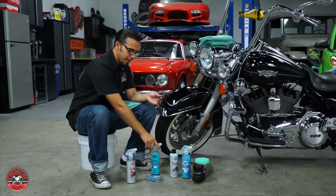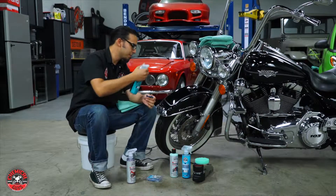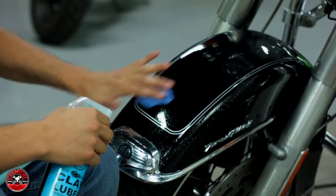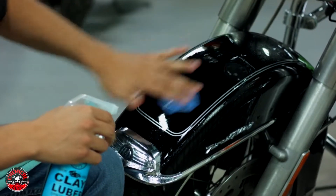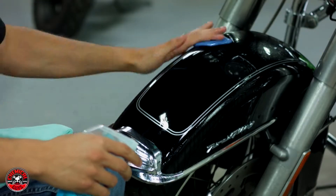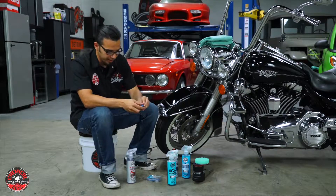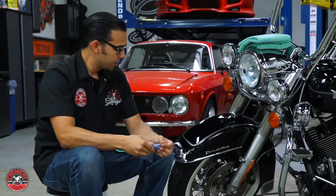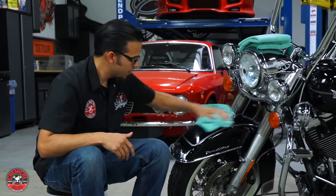Before you put it on the paint you want to lubricate it using a clay lube. You can spray it directly on the surface - I spray it on my hands because this is very sticky. Be pretty generous with it, spray it on the surface, then go to clay barring. You want to go back and forth in straight lines, no circles, with light pressure. As you start off it will kind of drag, but as you go over it and add more lubrication it's pulling off the contamination and will start gliding. Once the surface is feeling slick and smooth, put your clay bar away in an airtight container so it's ready for next time and won't dry out. Then wipe off the surface to remove all excess clay lube and contamination you just pulled off.